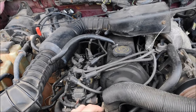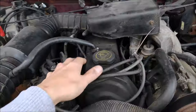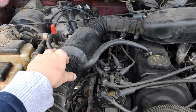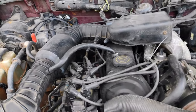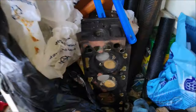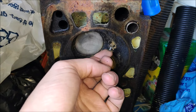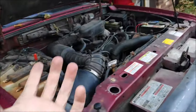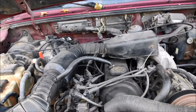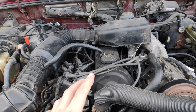The 2.3 has some problems — the pistons are pretty weak and they like to crack. On my '96, three out of four pistons were cracked. There was a lot of blow-by, fumes were going into the intake boot, and the engine was running lean. I pulled the head off thinking it was a head gasket, but that was fine. I pulled the pistons out and they literally fell in two pieces.